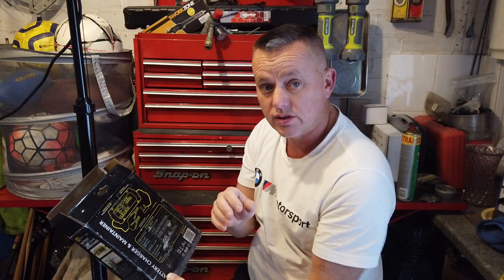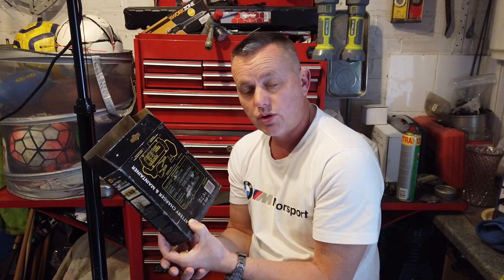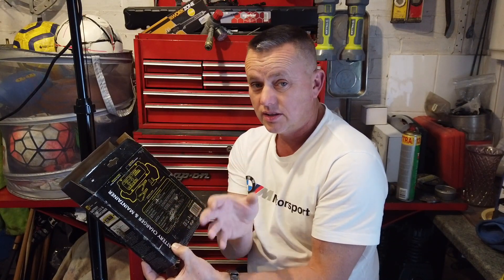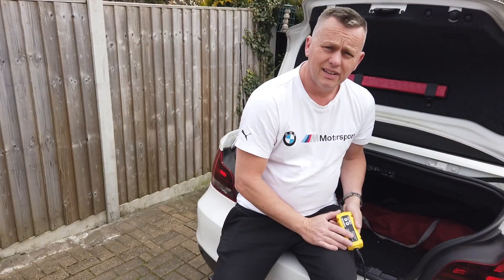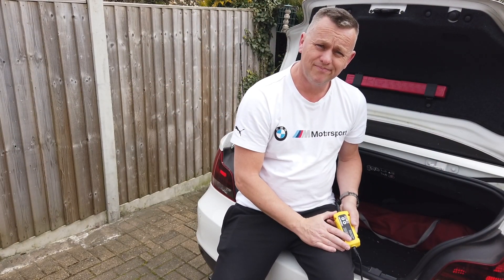There are plenty of makes all very similar to this - I'll put links in for a few different ones so you can make your choice. These are really good for motor homes too. If your motor home just sits on the driveway for a few months, you might think you're doing it a favour by running it for 10-15 minutes, but if it's a diesel, the glow plugs take all the power and the battery is hardly getting anything. One of these maintainers is a perfect way to keep your battery fully topped up and ready for when you want your campervan. If that's been useful, drop me a thumbs up, like, subscribe - thanks for watching.